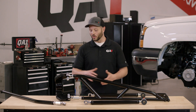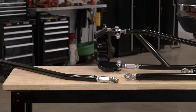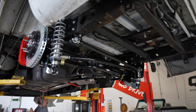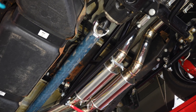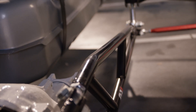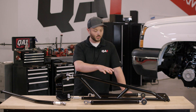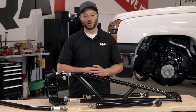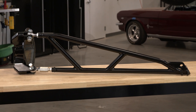Let's take a closer look at a torque arm system. I get this question a lot from customers: what is a torque arm system? It looks pretty complex — there are a lot of attachment points, adjustability, a lot going on here. Definitely more complex looking than the leaf spring setup that we just took off. But keep in mind that QA1 engineered this system to function properly and give you great results. In effect, it's just a link-style system, and what the various links do on a rear suspension like this is keep the axle located properly in the vehicle, as well as allow you to tune how the power is applied through the chassis.